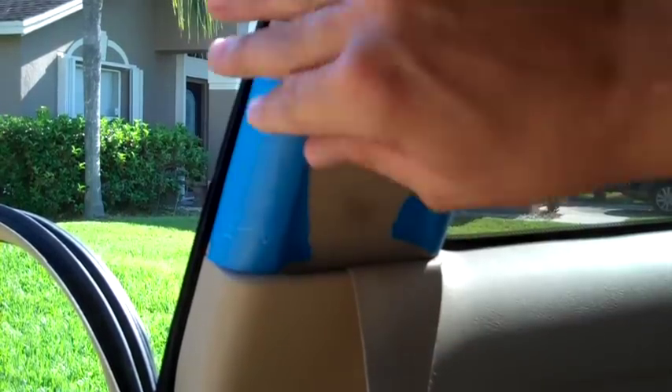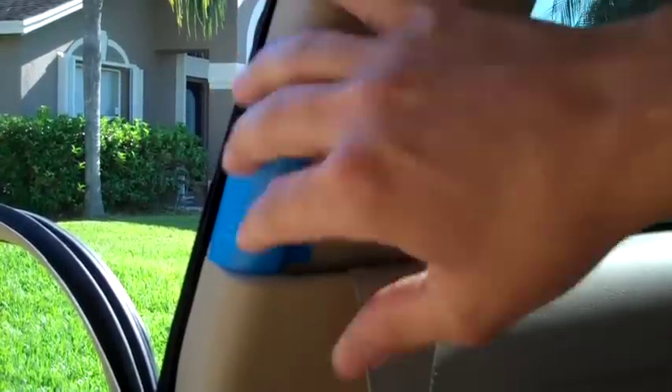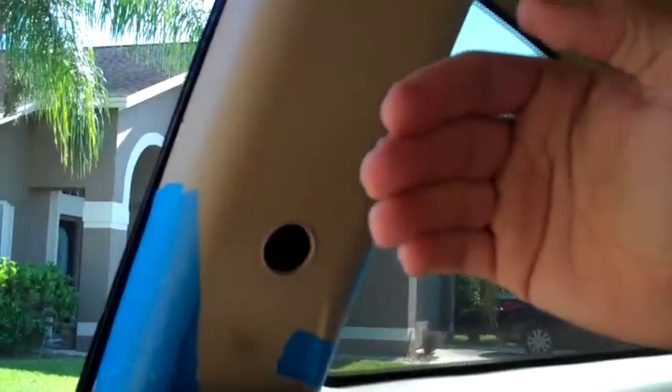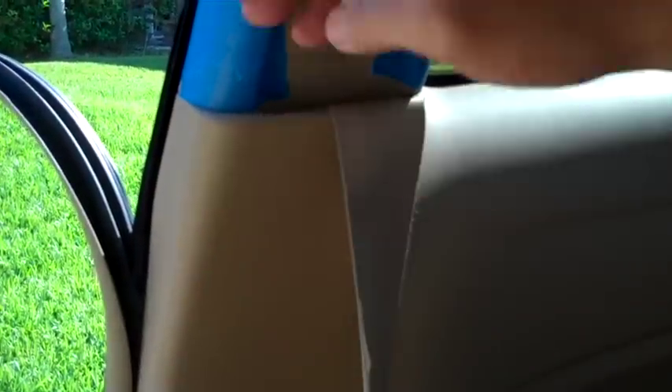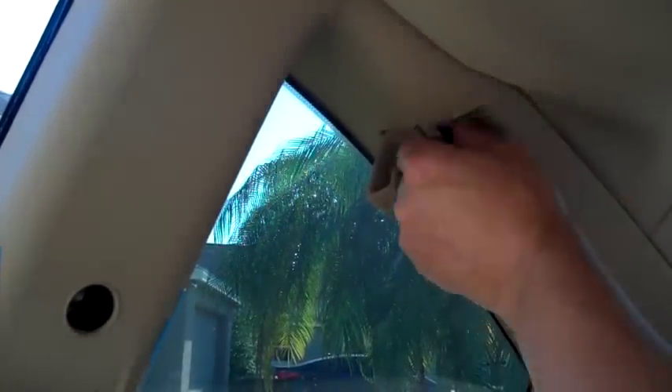For the next part, I'd recommend putting a bit of masking tape on both sides here, because you're going to get this piece to pop out and also pop this other piece out. This piece is going to slide down, allowing access to remove the headliner. Pull back the weatherstrip a little bit, grab around the edge, give it a little tug — you see it comes out. This is where you want that tape protecting, because it's going to be rubbing on the outside.